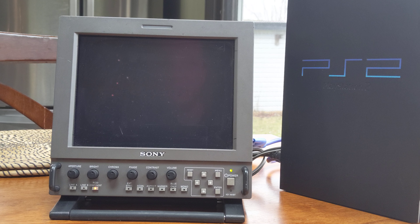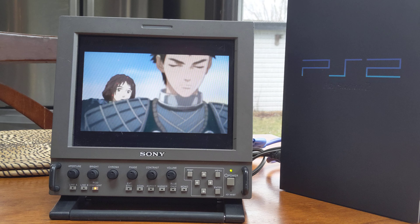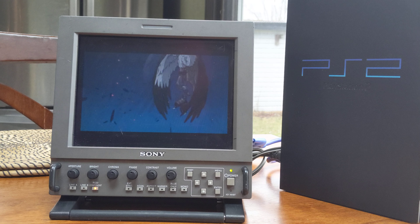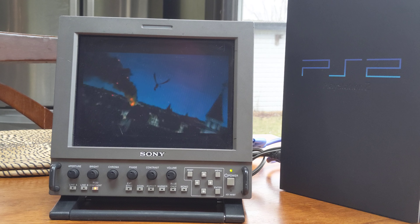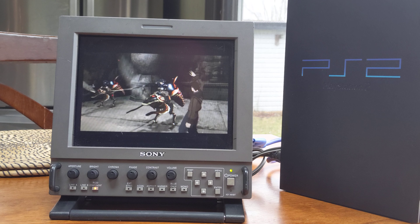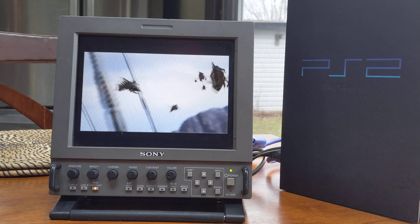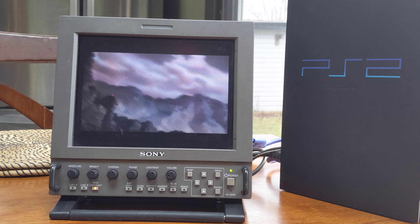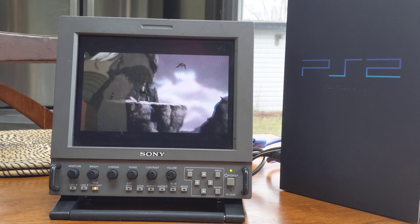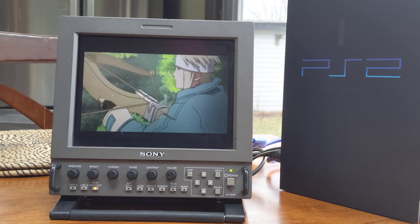This is the stability we're looking for. I have here basically a portable PS2 setup — I can easily carry the PlayStation 2 and easily carry this monitor, I need two power cables, hook them up to each other and I'm golden. The reason why the PlayStation 2 works really well is that this was that generation of gaming where they were transitioning from CRTs to LCDs, and the programming of the consoles was done in a way where the sync would line up with monitors like this very, very well.